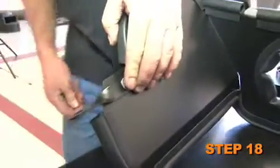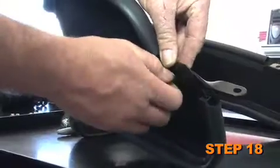Install the mounting bracket onto the heat shield with the provided hardware. Remove the bolt which secures the ground strap to the cylinder head as shown. Using the bolt removed in step 19, secure the tube mounting bracket and ground strap to the cylinder head in the same location that the bolt was removed from.